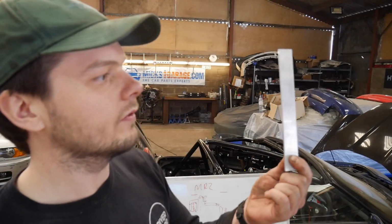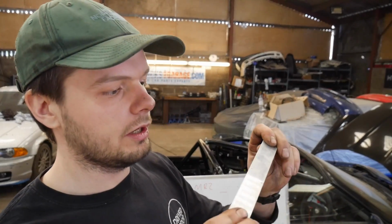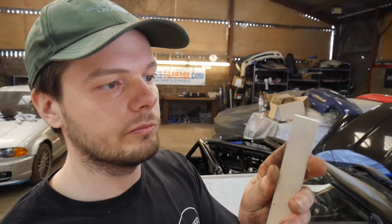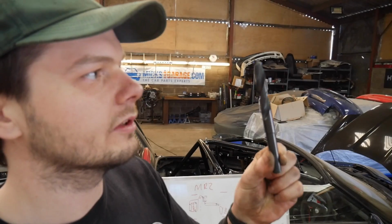So when it comes to mounting them, all I've been doing is finding somewhere where it looks like I want them to go, getting a bit of alloy flat bar. I think it's 3mm, but we'll see. And then, yeah, put it in the vise and bending it as tight as I can, because I've been trying to not waste, and I did have to buy a 14mm stepped little drill bit for this as well. I did have a 13mm for the engine bay ones and a wiggle, but for the cockpit we're going to do it properly with a 14mm drill bit.